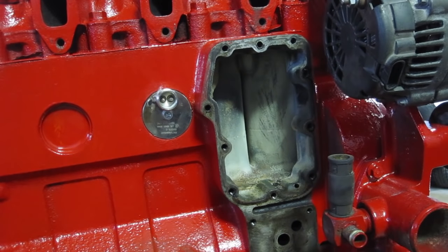Change your coolant filter every time you change your oil. They're cheap enough, and unless your manufacturer specifies a certain interval, it shouldn't be a problem to change it every oil change.